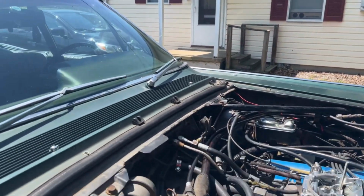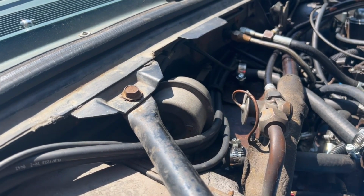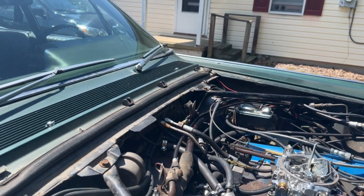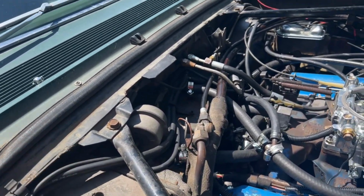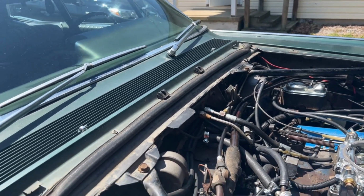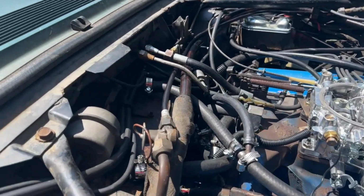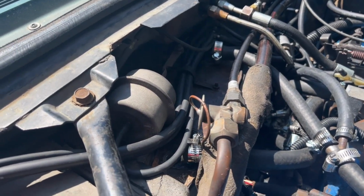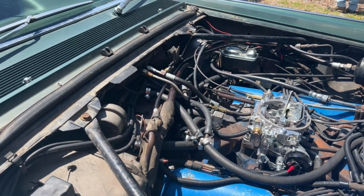I don't have door locks, so that's probably just holding vacuum for my wiper system and my trunk release, I'm guessing. But it also says in the shop manual, do not get them reversed. I don't know why it would make any difference whatsoever, but since I read that admonishment, I'm going to trace the line for the heat AC system to make sure it's actually plugged into the correct place. So I think I've covered every vacuum line that's under here. Pretty sure I have. If you have any questions, feel free to leave a comment or send me an email.